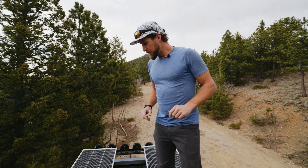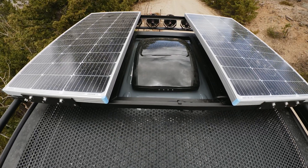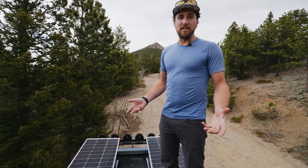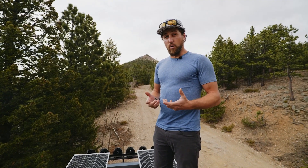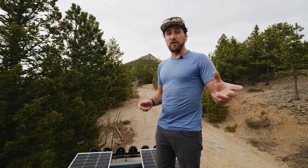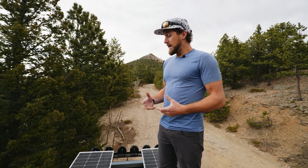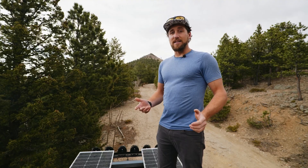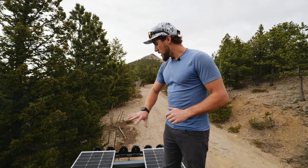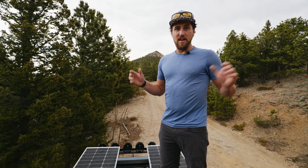This particular build has our touring roof rack with all the lighting up front. We actually opted for 200-watt panels instead of our standard 330-watt to leave more open decking up top to make the most of the roof rack. On a 144 build, if you stick with a 330-watt panel it essentially takes up the entire roof space, especially with an air conditioning unit and fan. By switching to two 100-watt panels, while it does reduce your overall solar, it gives you a lot more usable space for accessing storage or towing rafts or kayaks.